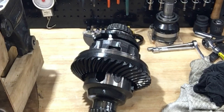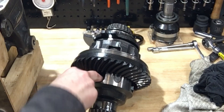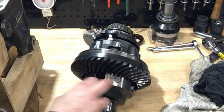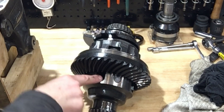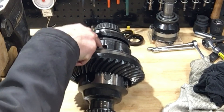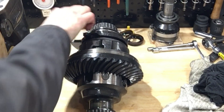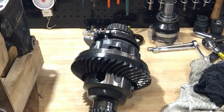This is the carrier out of the electronically controlled differential. We can see the pinion, or the sun and planet gears down here, which provide the differential action. These shafts go through and the differential gears are buried inside. Above here, we have a whole bunch of friction discs, and this must be the motorized engagement mechanism for those friction discs.